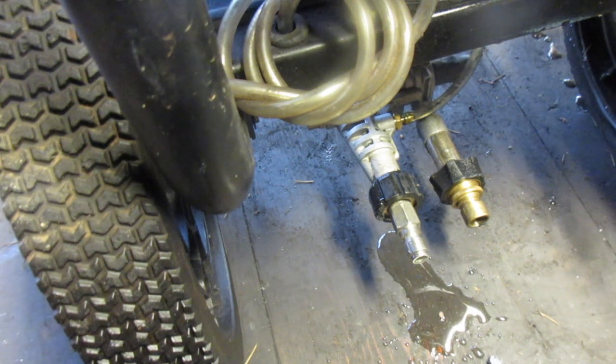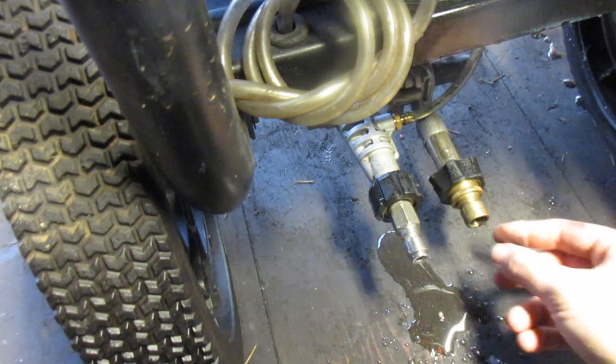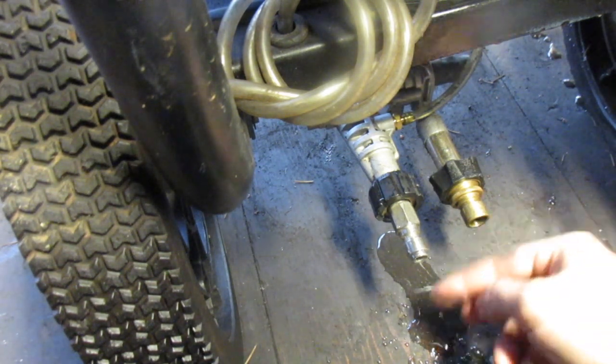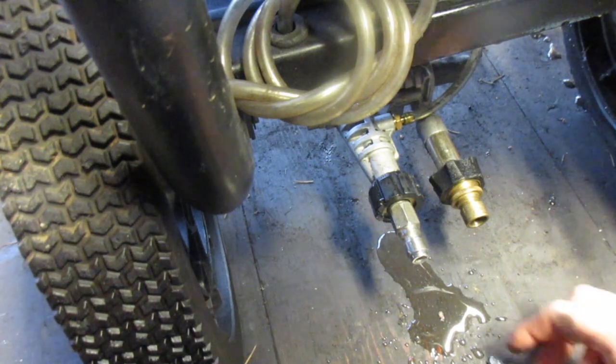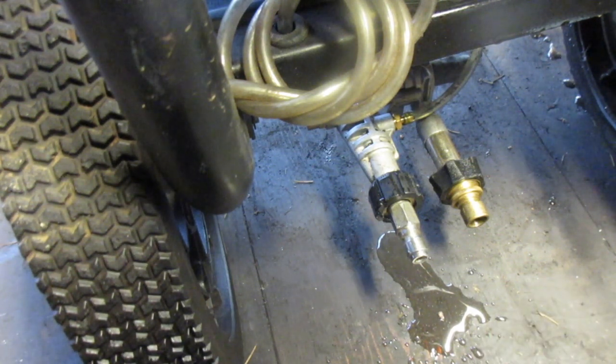When looking at the shaft, I don't see anything dripping down like I did before. And I think when I get my new wand, I'll still double check this before going back to its owner, or new owner, I guess. But this should be taken care of. I don't see any potential problems anymore. So, okay, if your Honda engine is leaking a profuse amount of oil, or a substantial amount of oil, then check that oil seal. It might be bad, like this one was.